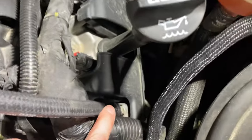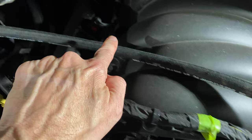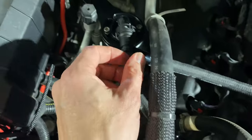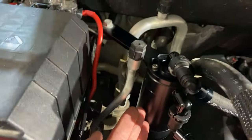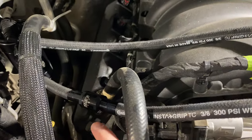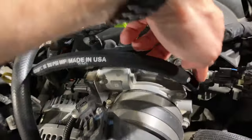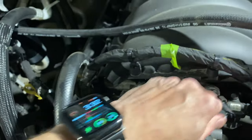So what's going to happen now is all the blow-by gases — any mist, oil, contaminants, unburnt fuel — are going to travel along there into the catch can, get properly filtered out, and then clean air is going to go back through this one-way check valve so nothing can go back into the can, and it's going to come into the throttle body. Pretty simple install.